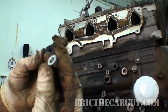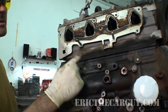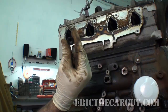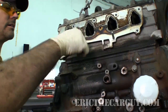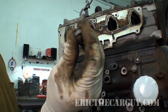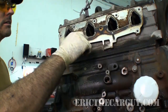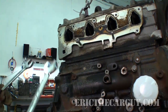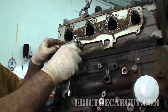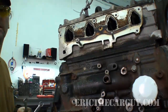I'm going to take two of the existing nuts that I already have from removing some of the other components. I'm going to take one and put it on backwards — so I'm going to put it on like this, facing this way. Thread it down about there. Then I'm going to take the other nut and thread it over the top the normal way. Since these are 13 millimeter, I'm going to take two 13 millimeters and tighten those nuts together like so.